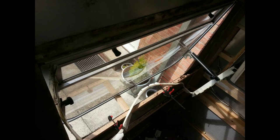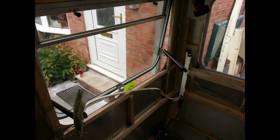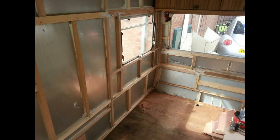That's the window sink — took the window frames out. You can see from the inside the windows had rotted around there, and the battens were rotted away. Starting to build the battens back up around the window in the same way I've done the rest of it — Sikaflex'd, screwed together, bonded to the aluminium. Quite a bit of batten being re-put in here; I've reinforced and added extra bits in.